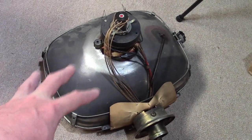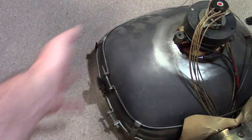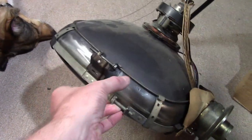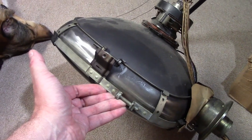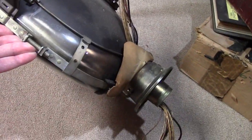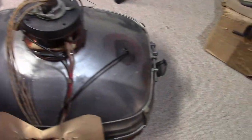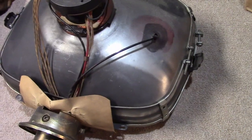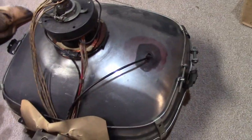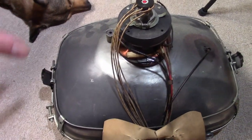Now hopefully you'll never need to break a Predicta head unit down this much. But if you do, take off the side nuts after removing the band on the plastic front and you'll be left with a heavy steel band with a hoop attached to it — that's what holds the CRT and gives you mounting points. There's a steel band that goes all the way around it, attaches to the bottom swivel and the arms attach on the sides. There is a screw you can tighten down on either side that provides the tension to hold this in place. Don't go crazy — if you tighten that too much, you can shatter the picture tube.